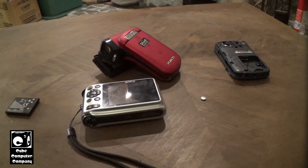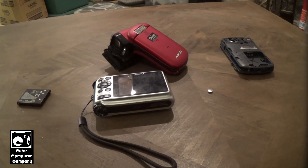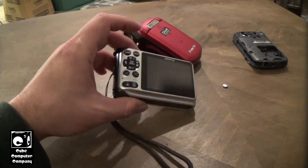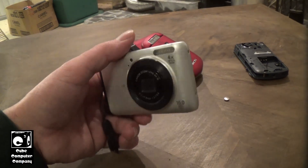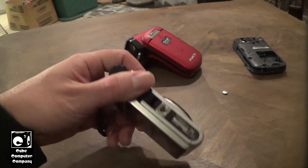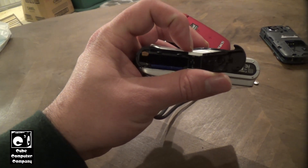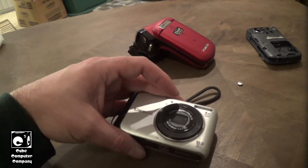For older cameras from way back, like mid-2000s or older than that, it was more common to have replaceable primary time retention batteries — a little bitty lithium primary cell that could be replaced pretty easily from the camera exterior, not requiring you to tear into the camera. I don't really have any examples here at the moment to show you, but I used to have a Canon camera — actually two different Canon cameras way back in the day that took AA batteries, just to put it in perspective how old they were. You would open this up, and you would actually have the slots for your two AA batteries, and there's an extra slot in there that housed the primary lithium cell for keeping date and time. So that when it failed or died, you could replace it.